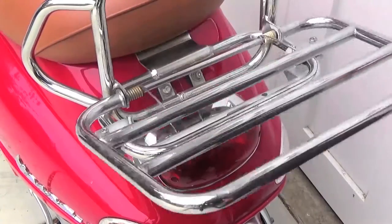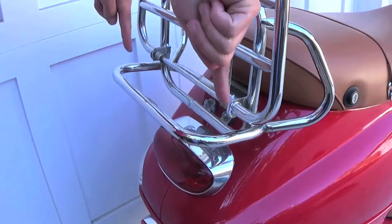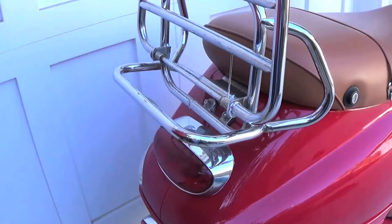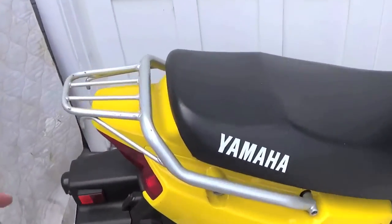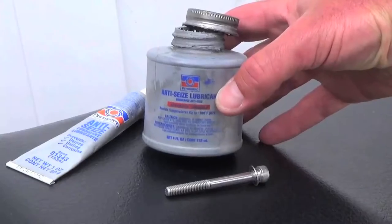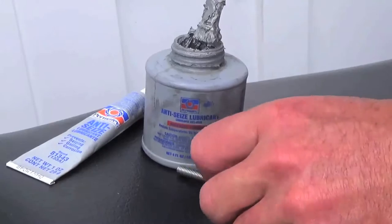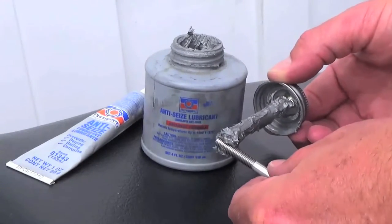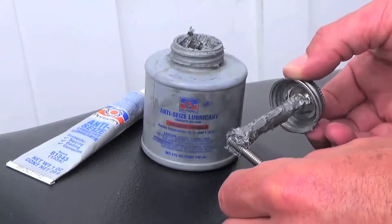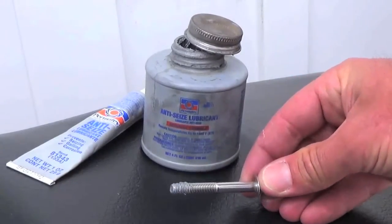For best results, look for mounting locations with a pair of rack tubes that are nearly parallel and not more than 10 inches apart. Check the weight ratings of your moped's cargo racks to ensure that they can handle the extra loads imposed by the surfboard racks. As a general rule, we always recommend putting common stainless steel anti-seize compound on all of the stainless steel bolts. This will prevent hardware galling, which is common with stainless steel, and ensure that you can remove the rack later if desired.